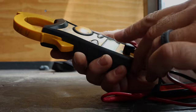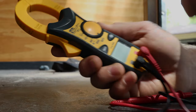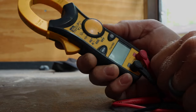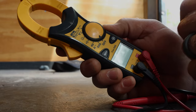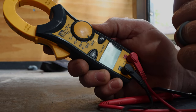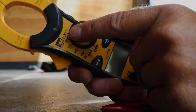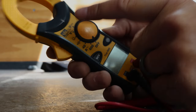This here is an Ideal — it's not always ideal, but it works well. Just kidding, my jokes aren't that funny. When checking voltage on the battery, it's DC — direct current. Up at the top here, this is volt because we're checking volts, and it's a straight line with dots — that's the DC setting.